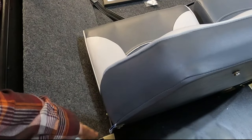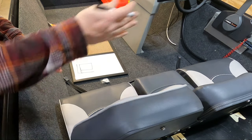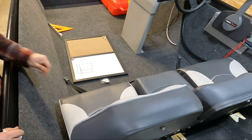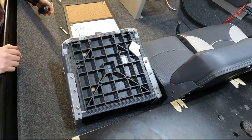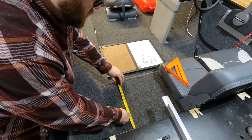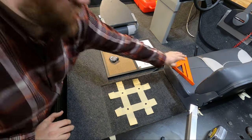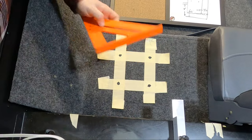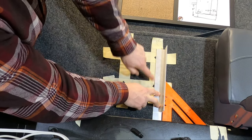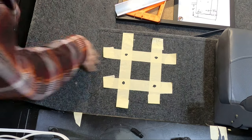I have two inches from the back wall to the corner back of the seat — that's going to be my main measurement for front to back. I'm going to match that up on all the seats, which puts it nice and flush with the front of the seat platform. That puts the back row of holes at seven inches off the wall. Now I've got to make sure this is square with the wall. I'm going to take my square, put it up against the wall — that's right down both of the holes in the center. So for this seat, this is where we're going to mount it.